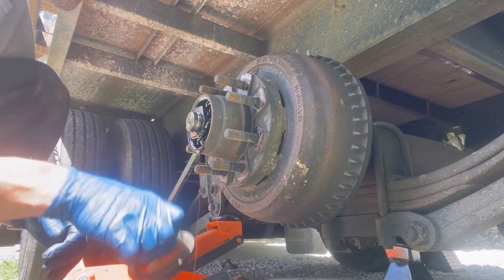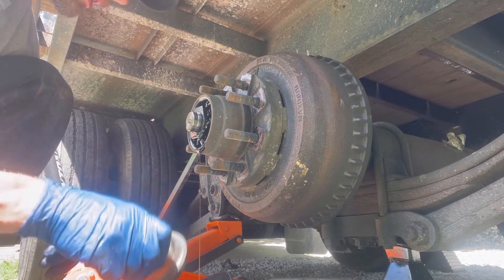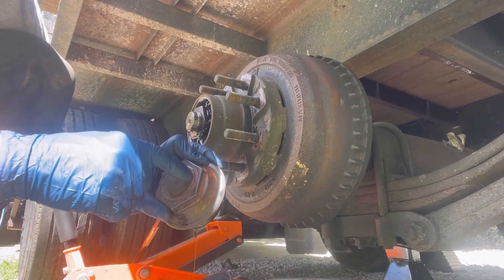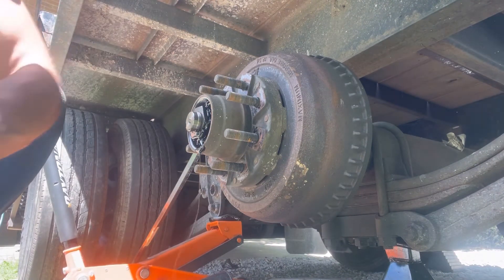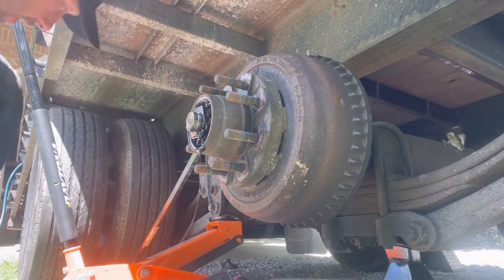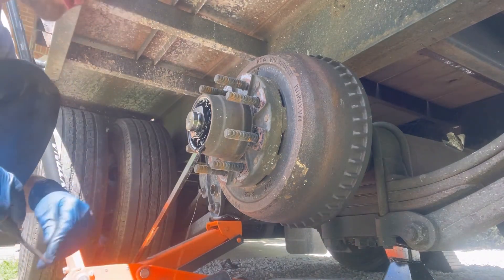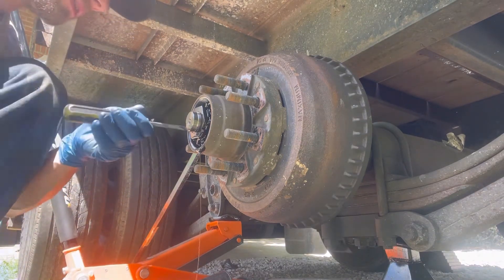The biggest thing is knowing what you're doing, following along, and keeping tabs on everything. Take pictures if you have to. This is torqued to 15–23 foot-pounds, so a good torque wrench will help you out. You'll need a pretty big socket. This is especially important for guys who've worked on pinions and rear-wheel-drive vehicles.